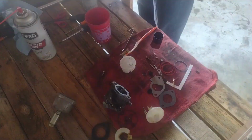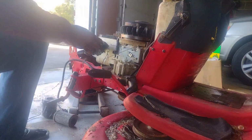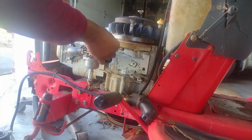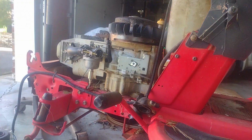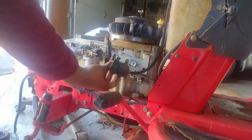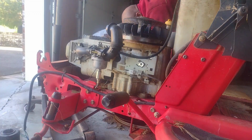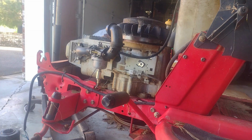a second time. The most important errors being that the jet provided in the kit was the wrong size, the needle and its bore in the float mount was the wrong size, and I also didn't install the needle correctly in the seat. So I basically ended up using nothing from the rebuild kit except the gaskets. But after getting the assembly back together, it ran beautifully.